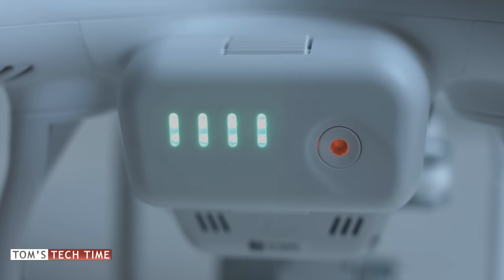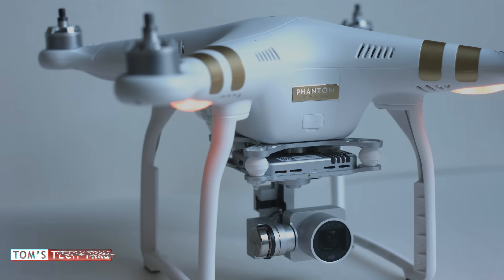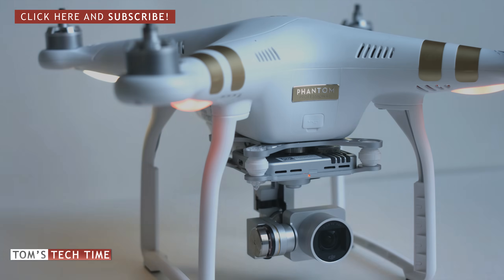Now insert the micro SD card into the gimbal and start the copter. Give it a few seconds to start the updating process. The noise you hear tells you the copter has started updating. Updating can take up to 25 minutes or even longer depending on the firmware update. Your copter is now updating itself, the gimbal, and the battery. Don't be afraid if the gimbal turns itself on and off a few times or moves around, or when you hear noises from inside — this is normal and part of the process.